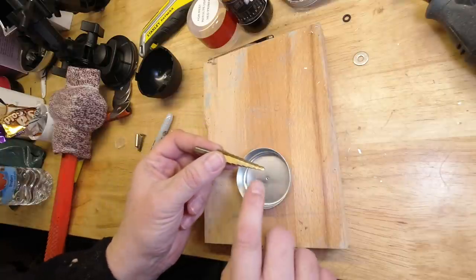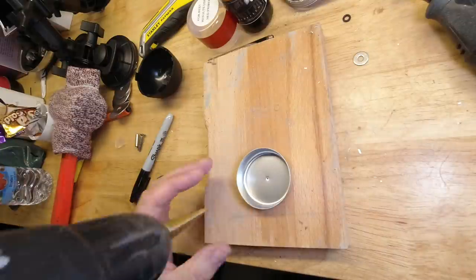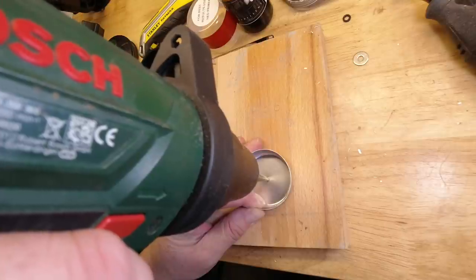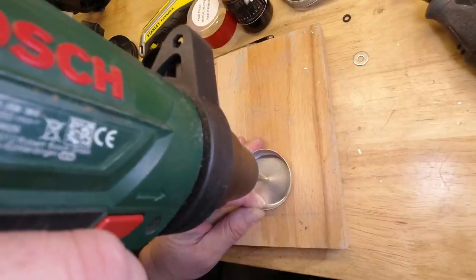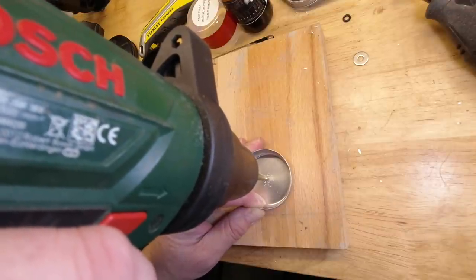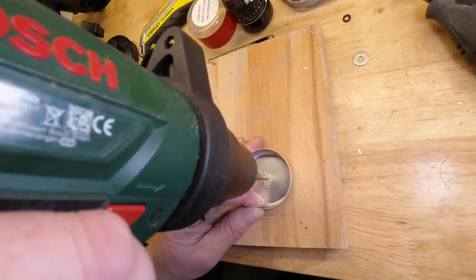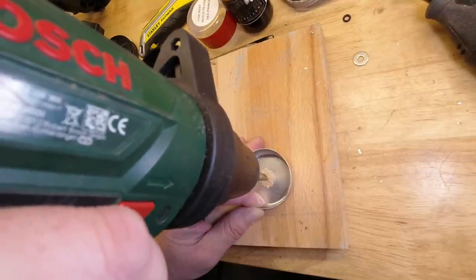And then we're going to use our cone drill, and 5mm is the second size on this, so again, relatively easy. Use no weight at all. Let the drill do the work and be pushing down on a hard surface like my little block of wood. And I think it's nearly through the first one. Yep, that's through the first hole. So what I'm going to do now is just let it cut down till it puts the second size hole. The block of wood slows its descent.